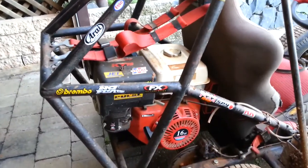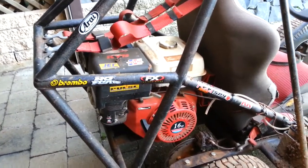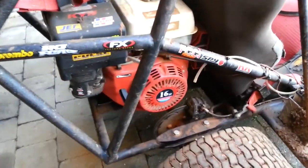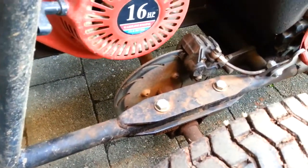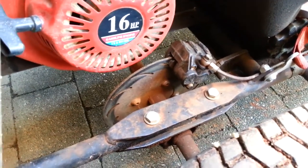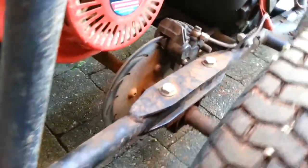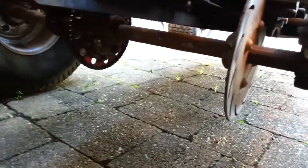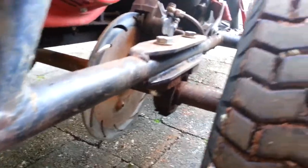Honda copy motor, 16 horse — probably got a bit carried away with the horsepower there, but it actually gets up and goes pretty good. That's how I've got around the round bottom part of the chassis — just put a bit of flat bar either side of it so the bearing can sit on it. That's the axle bearings and disc brakes set up from the Edge. It's got a mini stud pattern.